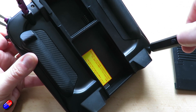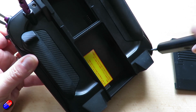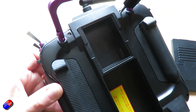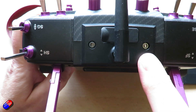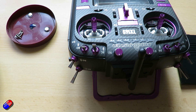I'm using my Squire electronic screwdriver here just to make this a lot easier — I'll put a link down below if you want to have a look at that. Once these four screws are removed, there are only two other screws to take care of: the two at the top, either side of the antenna. These are hex style screws, so you'll need a different screwdriver or some basic Allen keys to pop these out.